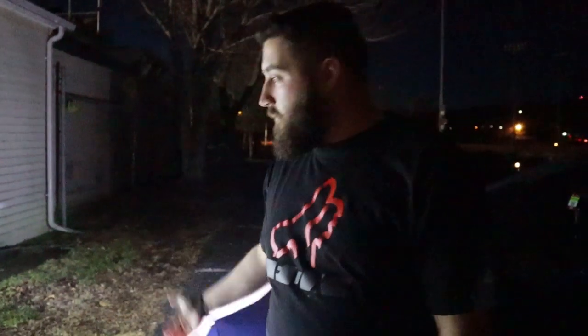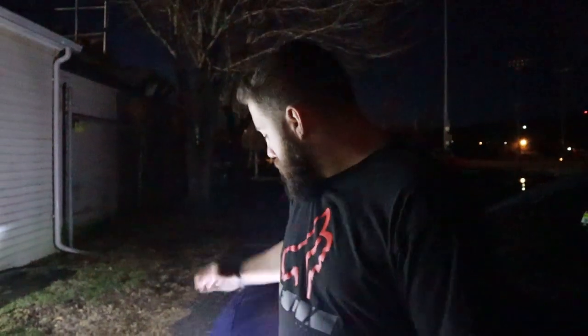It doesn't come with a switch. You don't need to run any wires through the firewall. It uses a relay that connects into the low beam. So when your low beams are on, your fog lights are on, which is what basically 99% of people do anyways. There's really no way that you would run just your fog. So we're gonna get that in. And I also got LED fog light bulbs. I'm also thinking about deleting the turn signal, so I might need to get the hyperflash relay if it does blink.